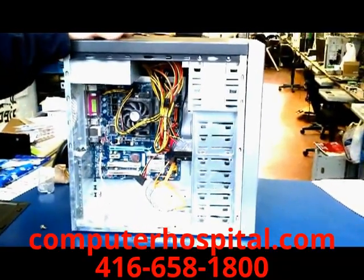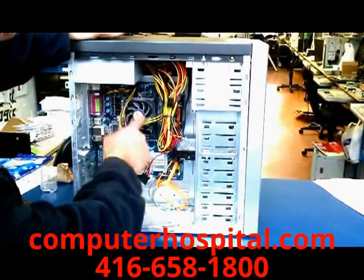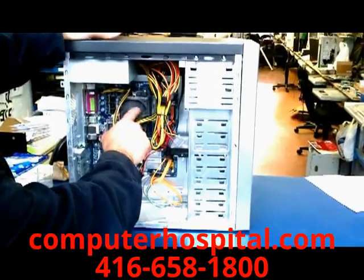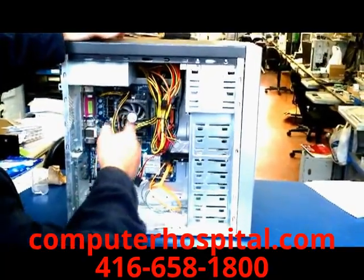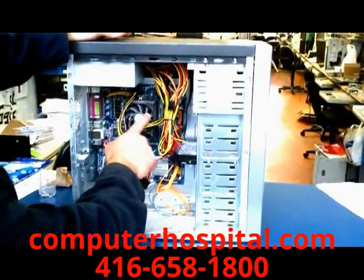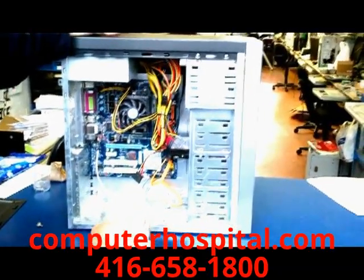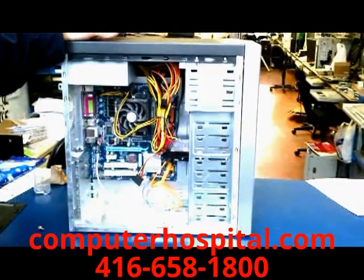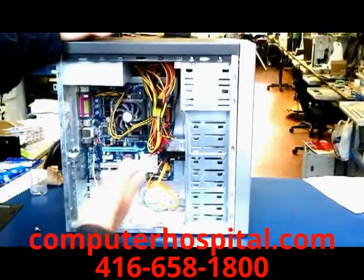Let's show you a few of the components on the motherboard. The one we're most interested in is the CPU fan — see how it's caked with dust? This will start to make noise, go out of balance, and actually wear out the fan. The heat sink, which is aluminum, tends to get clogged with a layer of dust like a carpet and eventually won't dissipate heat. The CPU temperature goes up, the fan increases speed to compensate, and if your fans are very loud, that's probably what's happening.